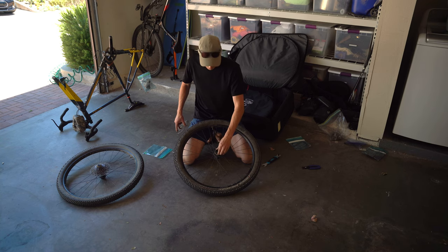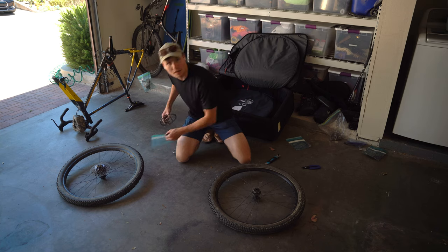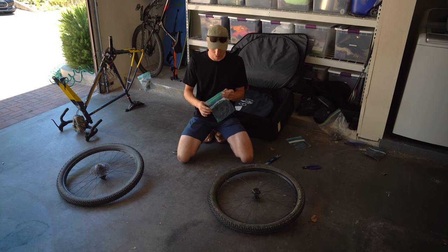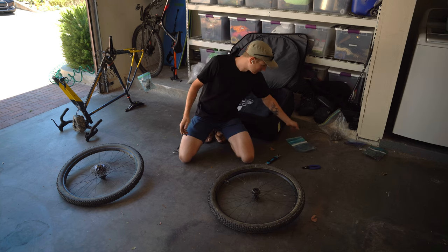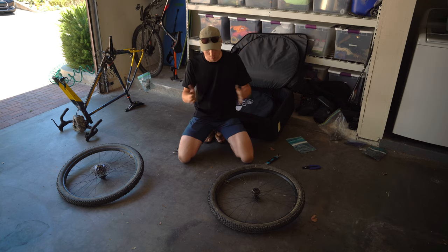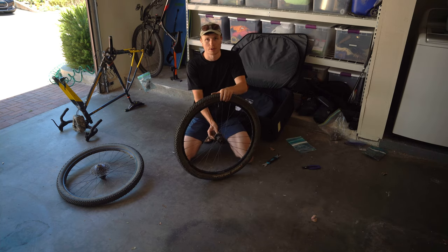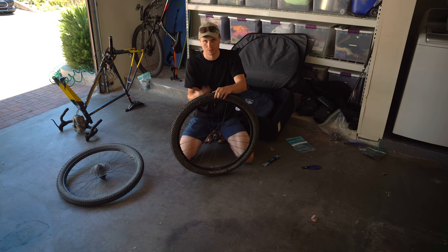These are not hydro. Hydro is a whole different ball game. With hydro, you need to put spacers in between your brakes, because they'll over tighten, and then you have to pry them loose at your destination, which also happened to a friend of mine recently. So I was able to get on my bike and ride right away, essentially, while he still had to go to a bike shop to get his disc brakes opened up. So if you're doing bikepacking and stuff, unless you know how to work with your hydro and actually fix it yourself, mechanical to me has been easier. It's been more straightforward, just, you know, Allen key, works.